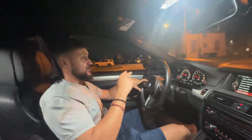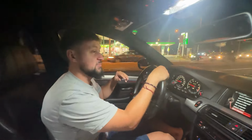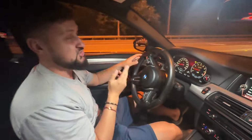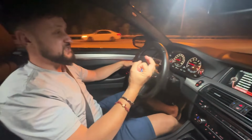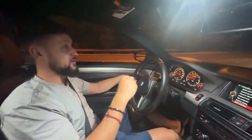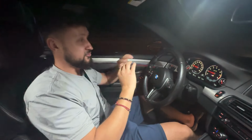I put in new rear sensors. I threw the same check engine light as I was throwing with the original sensors. So I'm like, okay, it can't be the sensors, it's something with the flow. The code was slow to respond from lean to rich condition, slow response. So the spacer I was using, I'll show you in a separate clip, had a tiny hole. I went and put the bigger size spacer in and reset everything, and so far all the systems for the oxygen sensors and the oxygen heater are active and there's no check engine light.